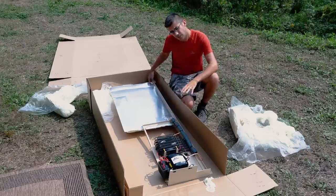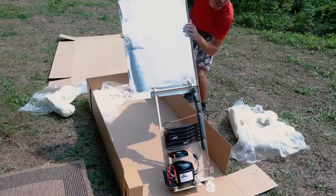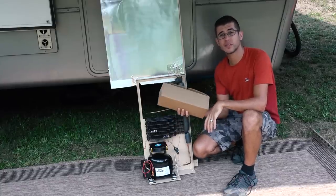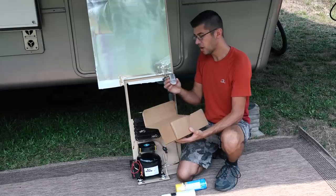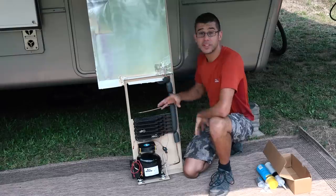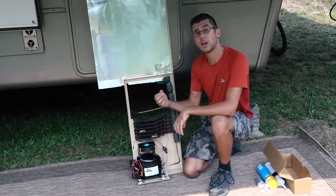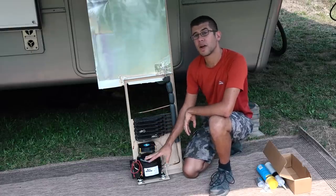They'll pack the unit for pickup or can ship it. Remove the packing material carefully — this unit needs to be tilted only forward, not side to side, because the coolant and refrigerant need to stay oriented correctly. In the accessories box you'll find heat-conductive thermomastic, Great Stuff foam insulation, aluminum tape, screws, and a replacement fuse. The unit itself is straightforward: at the bottom is the new compressor, which plugs into the existing refrigerator's control unit where it used to turn on the gas or electric heating element — now it will turn on this compressor instead.